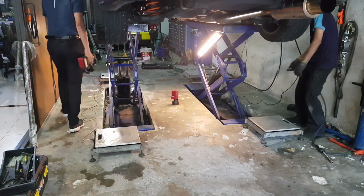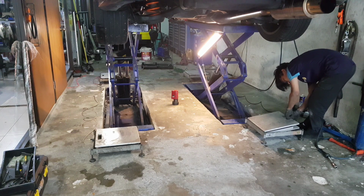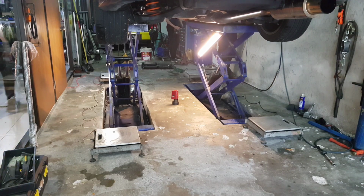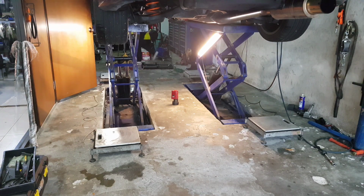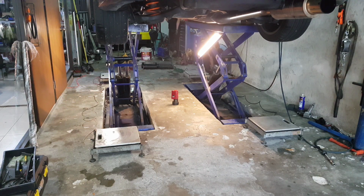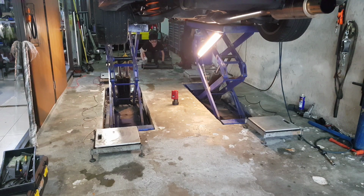So it's actually laser to actually even up, to make sure all 4 flat patches are on level ground, because as you know, in Malaysia 99% of our flooring is never 100% straight. So in terms of a couple of millimeters difference between each and every scale will likely produce a different result and deviation in terms of weight among all 4 scales, and we don't want that to happen when we're actually doing precision jobs.